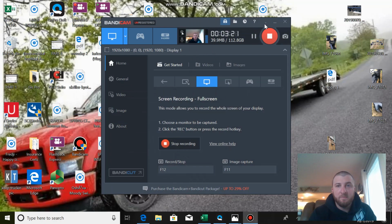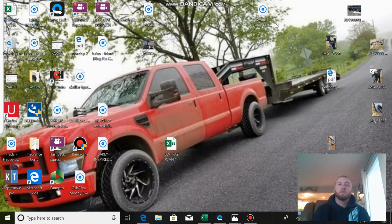So I go on, I'm trying to think, I think I ran the trailer enough where it started to wear the inside of the tire. It didn't really show it was bent until you put a lot of weight on it. So once I got that Tundra on there, that's when you could tell the front of the wheel was toed out, causing the inside tire, I call it scrubbing the tire, to drag across the ground, not rolling straight down the road.